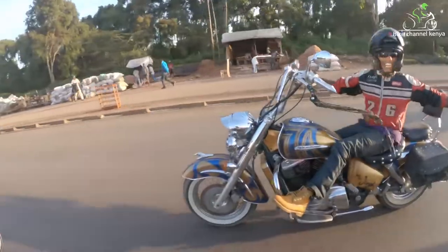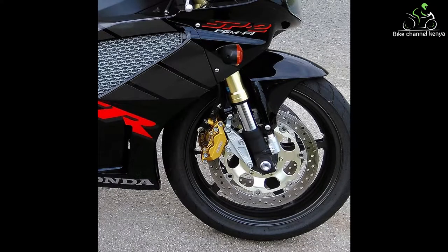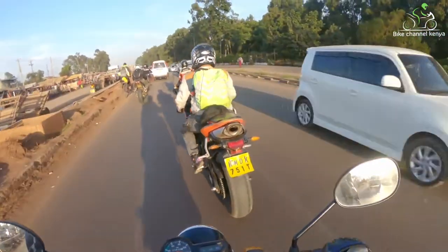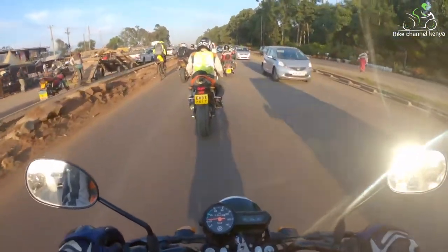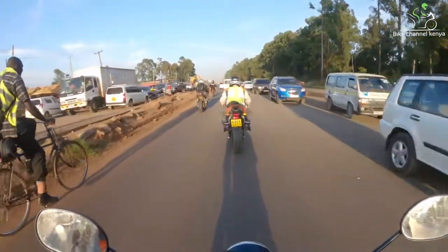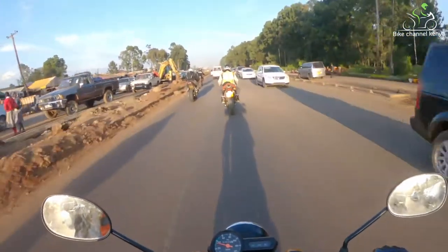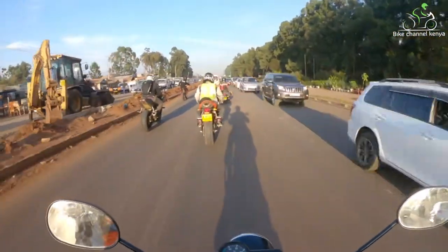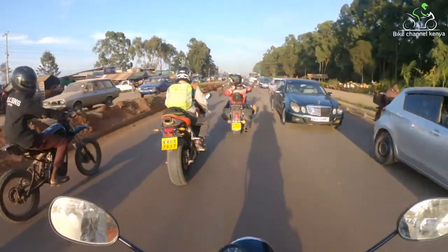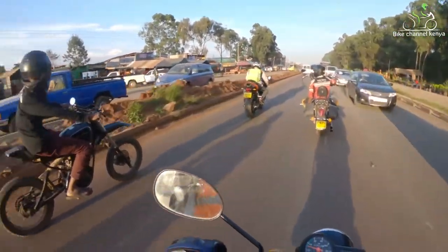With axial calipers, they are tightened from the side of the caliper. What that does when braking is introduce a little bit of play — not enough to make it fall off, obviously — but that play means you lose a bit of feeling, as the caliper is not always 100% aligned with the discs. When you are trail braking to the apex of a corner, that won't be very confidence-inspiring.